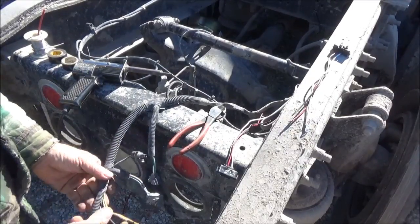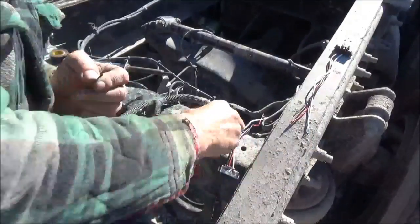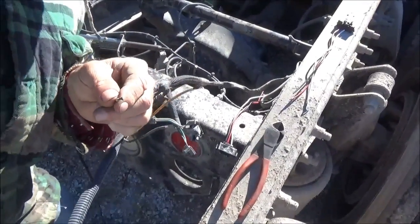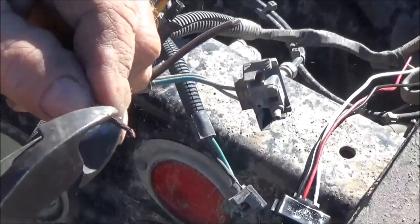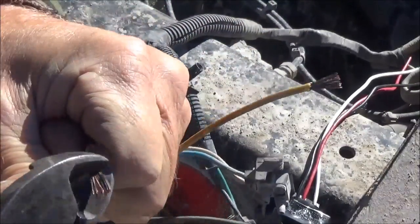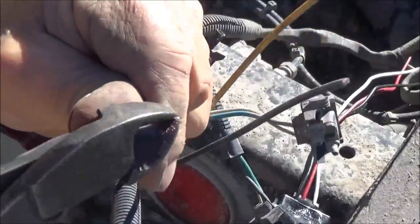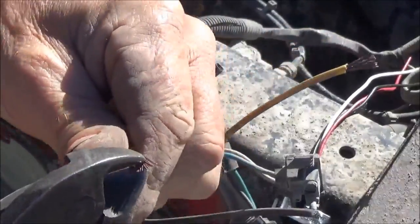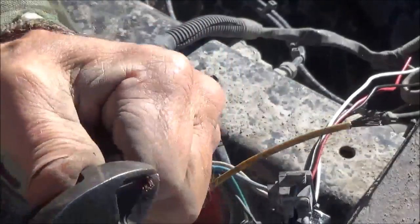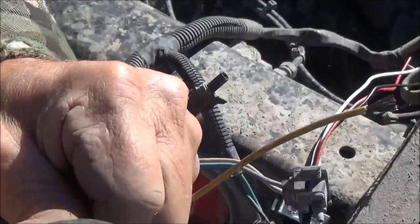Fixing these tail lights this morning. I still don't have a monitor to look at, so this little viewfinder on the camera's not the best thing to work with out in the daylight. I just stripped two of these wires. Now, I got this black coating on these wires — it's not a coating anybody put on there. It's just something that happens to the copper wire when it's been inside the insulation for a lot of years. I cut it back six or eight inches and it still has this black stuff.